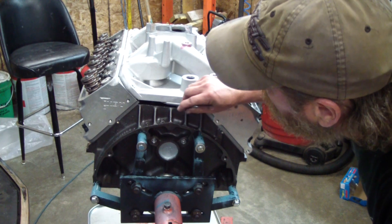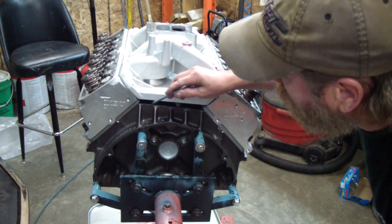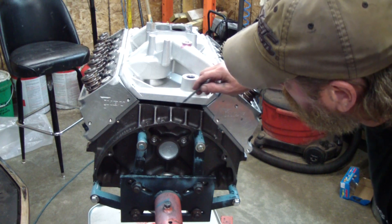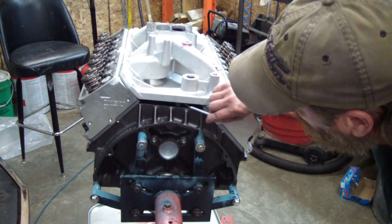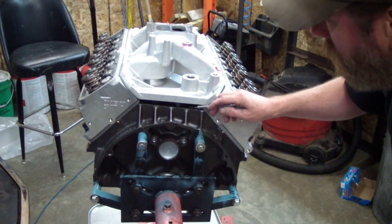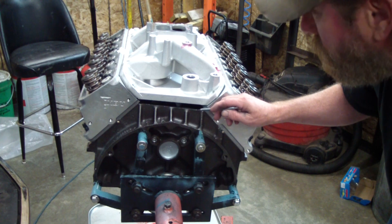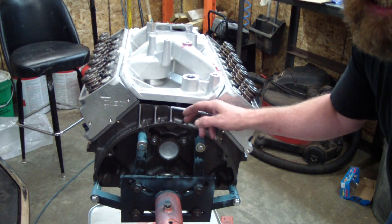This gap is going to be filled in with a piece of aluminum and then a bead of silicone at the bottom, attached underneath with countersunk screws. This area does build up pressure in there and you don't want to just have silicone — it would blow out.